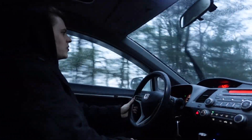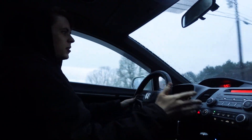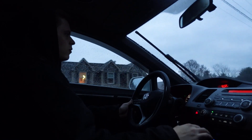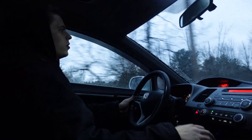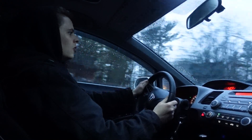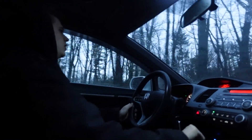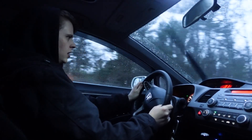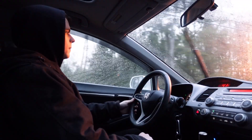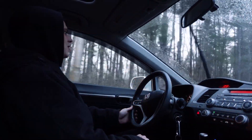Alright guys, out here on our test drive — this has been a huge improvement and I'm really glad we threw this mount in. The biggest improvement is that the steering wobble under acceleration, especially on that right side, is gone. The car also pulls way straighter, which is a lot more fun and confidence inspiring. It's also tracking the road much less and feels a lot more stable cornering at higher speeds. The car feels so much more solid — no more jiggles under acceleration. There's still a little bit of slop, maybe from the lower torque strut, so I think we're going to take a look at that next. If you guys made it this far I genuinely appreciate it — feel free to leave a like, subscribe, or dislike, and I'll see you guys in the next one. Peace.